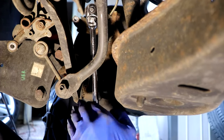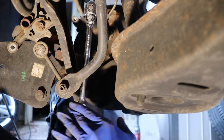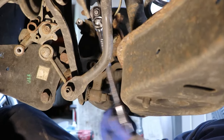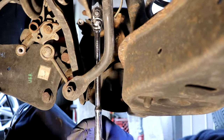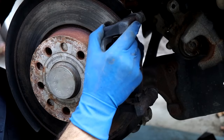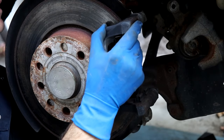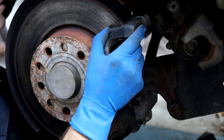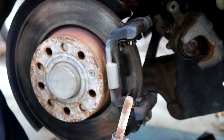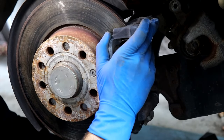The more corroded, the harder it is. Three weeks later, we'll get the bolt out — three weeks later. Alright, so we got the top one just about out. What I do is just wiggle it by hand as you're taking it out. Look at how long it is — and corroded. We'll make sure we anti-seize it up real nice. The lower one you can get with your Milwaukee.